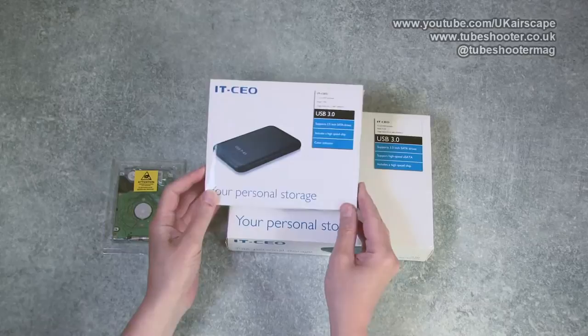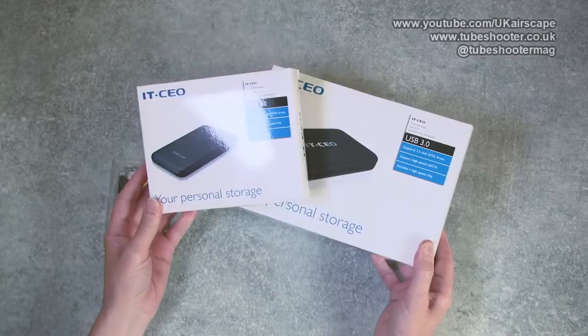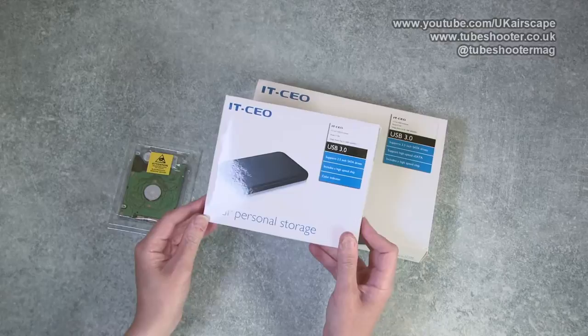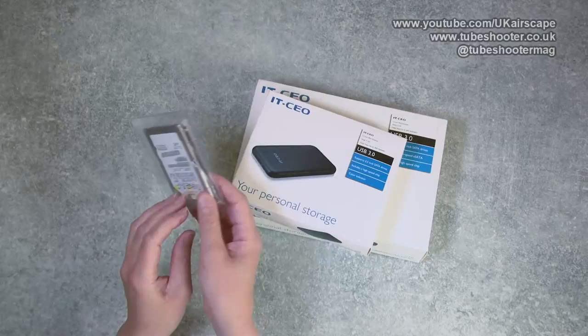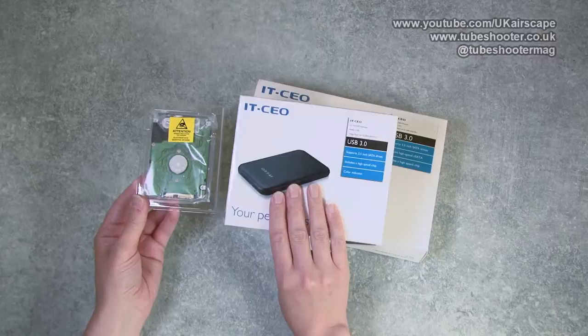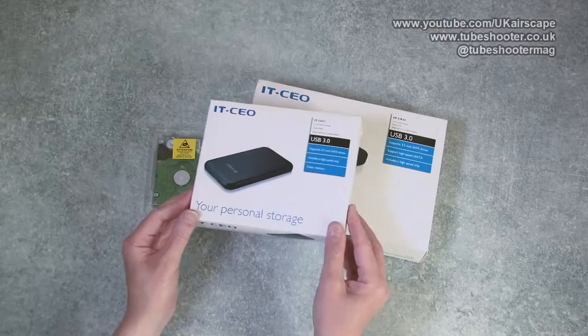This is a slight departure from the normal video making for this review - that's not to say these products won't be of interest to anyone doing video, because anyone doing digital video these days needs lots and lots of hard disk storage. These are hard disk enclosures, and by enclosures I literally mean there is no hard disk inside them - it's the box into which you would put a hard disk. You might say why not just buy one with the hard disk in it? Fair point, but if you have spare hard disks kicking around, like this one I took out of an old laptop that I've upgraded to a solid state drive, that leaves me with this perfectly usable - albeit quite small capacity, about 60 gigabytes - hard drive. I don't want to throw it away, and if I can just put it into a little enclosure and turn it into a portable hard drive, that's given me a new portable hard drive for less cost than actually buying a drive already in a box.